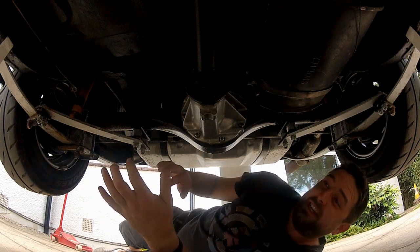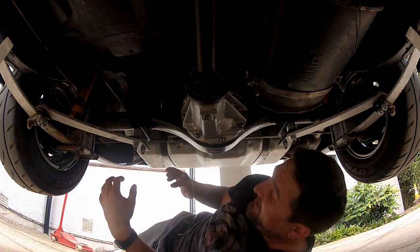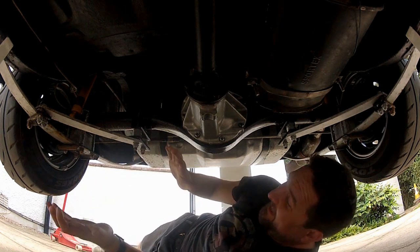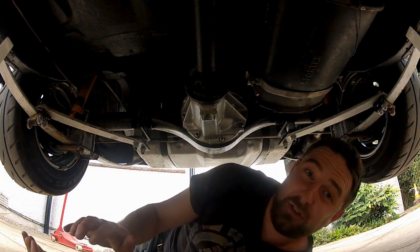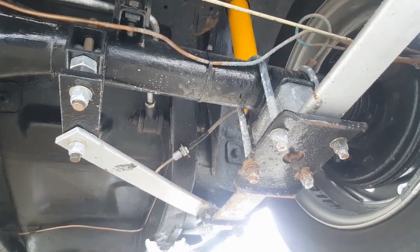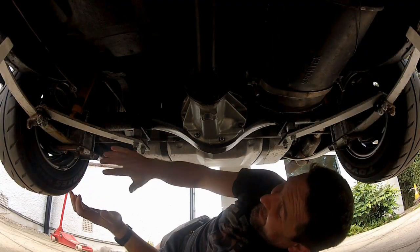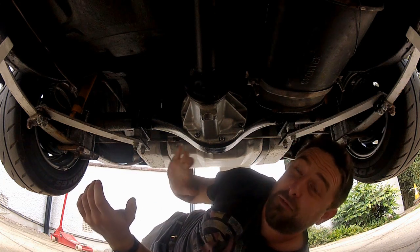Here's what we've got going on under here. This is often referred to as an A-frame kit. You can get an X-frame, which has two extra bars rearwards of the axle, but I went with the less-is-more approach and went for the A-frame. What this device is doing, basically, is adding triangulation between the axle and the leaf spring. If you know anything about structures, triangulation adds strength — it makes floppy things rigid, wobbly things solid. By adding triangulation here and here, we're making this axle a lot less prone to moving left and right, which is what we want.